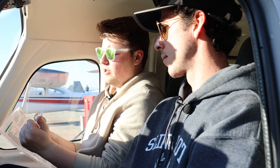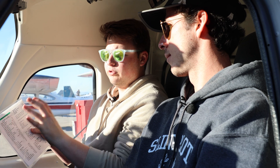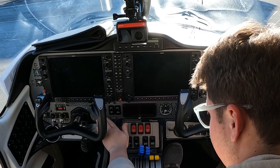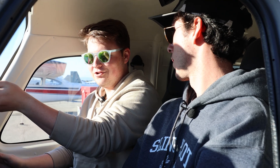To get things started for our pre-flight inspection, we're going to start in the cabin. Before we actually start revisiting the checklist, we're going to run through all the switches and make sure everything's turned off — just to get the plane set in a clean state. Starting off, you want to make sure the gear is down. That's the most important one. These ones here don't have squat switches, so if we turned the master on with the gear switch up, the gear would start coming up. That would be pretty bad — we'd have some people that would be a little angry at us.